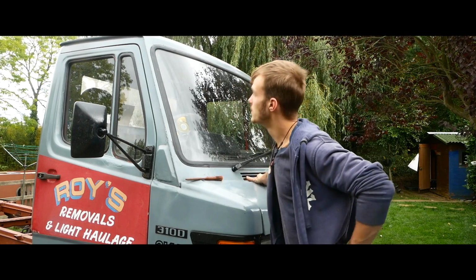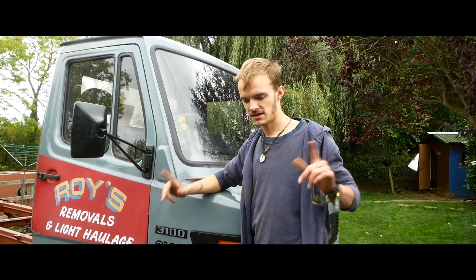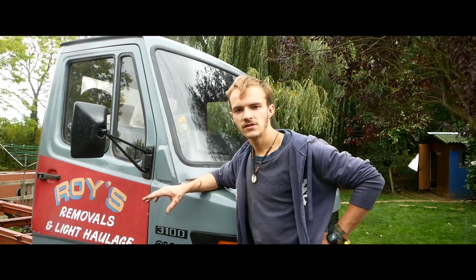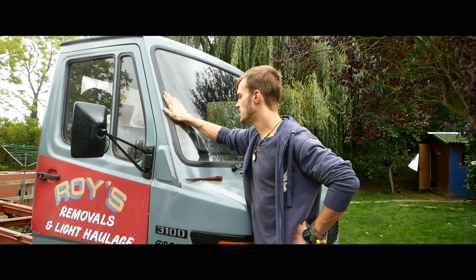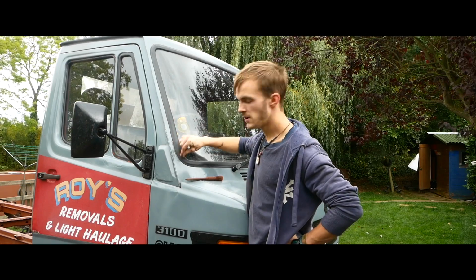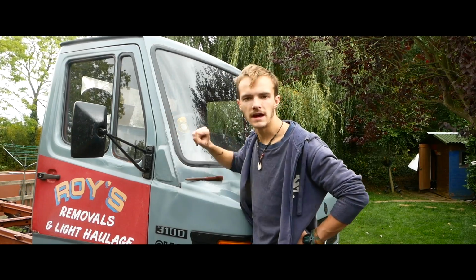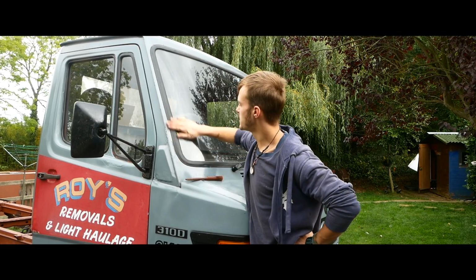Basically what happened was, as we were doing the last edge on the top, just at that last bit, we were doing it a method that you didn't use security bead. Sorry about the wind. We were doing it a method that my friend's done with rubbers with a security bead, where you pop a separate bead in after you've installed the windscreen and then you pull that out to push the windscreen out. But this one, it's not a security beaded one, it's just a solid bit of rubber.